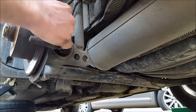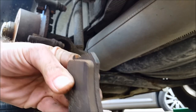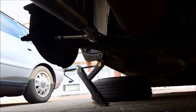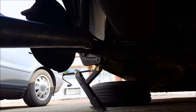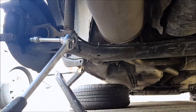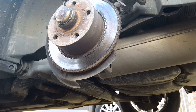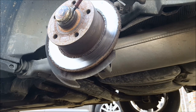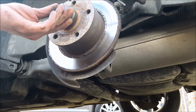These brake pads are not completely worn out and could still be used, but since we're fitting a new brake disc we'll use new brake pads and bearings as well. We are using Allen key size 8 to move the brake, and then a longer pipe to make it a little easier to remove. Now using a hammer and screwdriver to remove the cap from the old bearing.